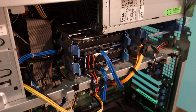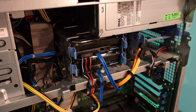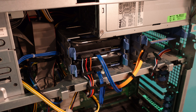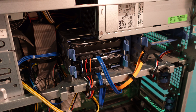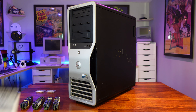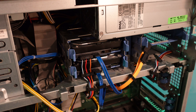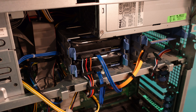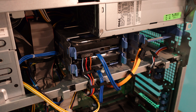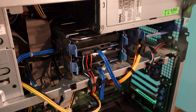Next I'm going to look at storage. You may recall I set up a RAID array using two Western Digital Blue SATA disks in the last video, and it works just fine. The issue is that even the fastest hard disks in RAID 0 are still not going to be as fast as an SSD, so I'm throwing in this 256GB unit from Kingston. I'll retain the RAID array as well for mass storage, but having the OS and a few selective programs on the SSD should give me faster boot times and a more responsive system overall.